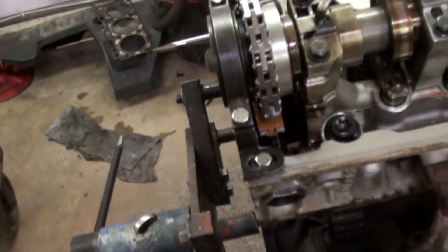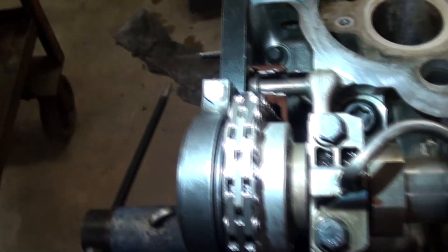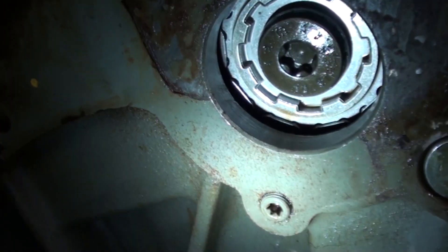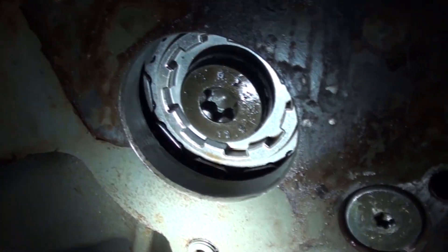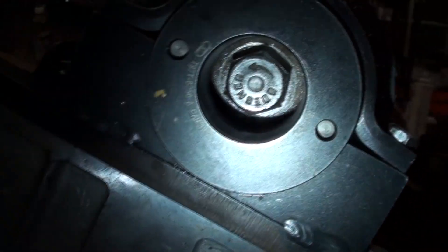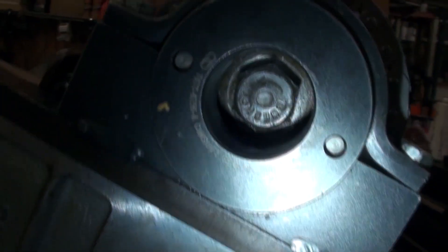Okay, so we're back again. The right-hand cassette here — as you can see all the timing components — there is a bolt right there and this bolt is the one that holds that cassette in. Here's the back side of your jackshaft; that is 15 foot-pounds plus 90 degrees is the torque on that. This bolt on the end of this camshaft, which is inside the special holding tool right now...